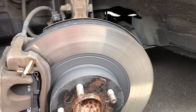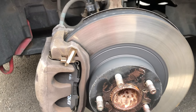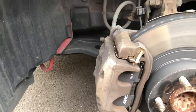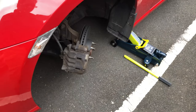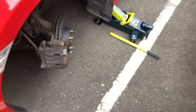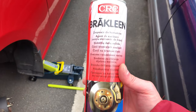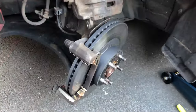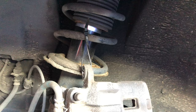To access the bolts, I'm going to have to start the car and use the power steering to rotate the wheel, and I hope the jack doesn't collapse in the process since the car will be pushed sideways a little bit. Now we've got the steering turned all the way to the left. I've also gone back in to pick up this brake dust cleaner, which is another very important product I forgot to take earlier. So now I've got the old brake pads off and I've cable-tied the caliper.